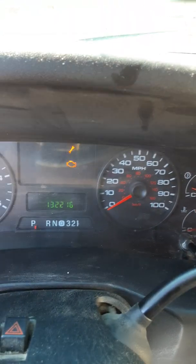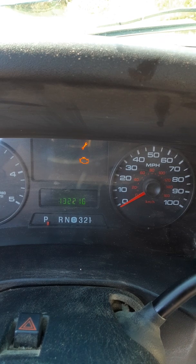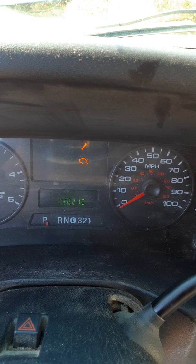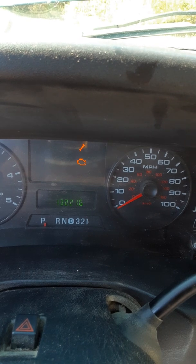When that wrench light comes on, I read some of the forums and it's called limp mode. That's when you're towing a heavy object going up a steep hill — it'll de-rate the motor to 30 to 35 percent so you don't blow the motor up. It gives you enough power to get off the road safely, maybe make it home. So in my diagnostics, this is the pedal.